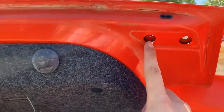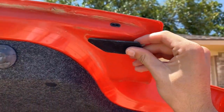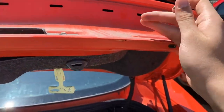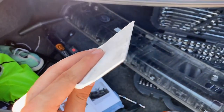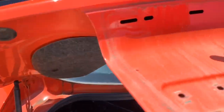Sorry guys, I forgot to film. I was kind of doing this on my own so I haven't had a lot of help filming, and I didn't have a tripod but I just got one. Just to catch you guys up on the install: I removed a tab that was right here — you just remove that, you can do it with your finger, it's not hard to take out. Then there were two screws inside, they are seven millimeters. I held my trunk at a 90-degree angle so they fall straight down onto the gaps. After that I took a plastic pry bar, like a spatula for painting, and wrapped it in here.